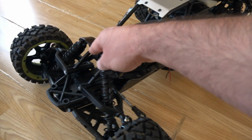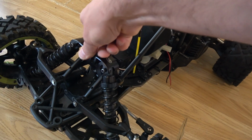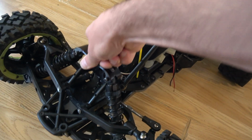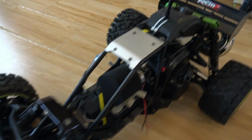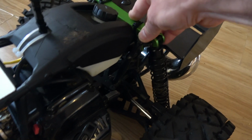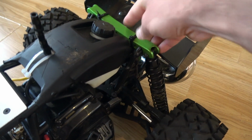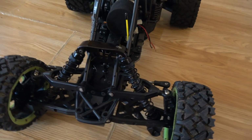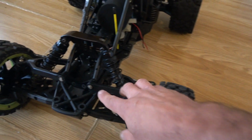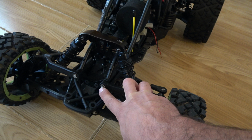I'm not massively into Bajas, I gotta say. The lack of steering always gets a little bit on my nerves. And I guess, to be fair, with this Rovan Q, that was even more accentuated with the lack of weight over the front. It's massively rear weighted, as you can imagine, and that's what, of course, it's for, really. So it pushes a lot at the front, and you really have to drive it in a certain way to get any steering out of it at all.